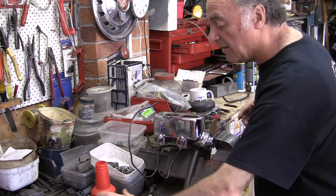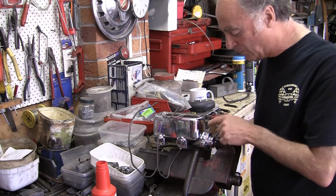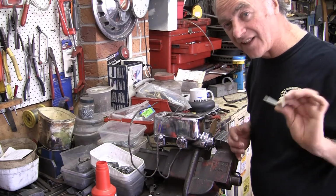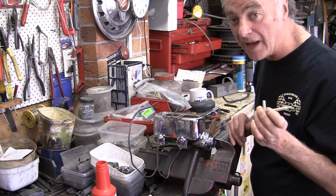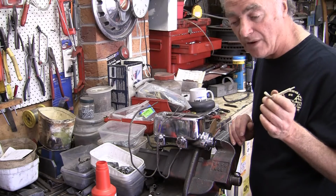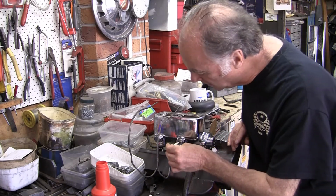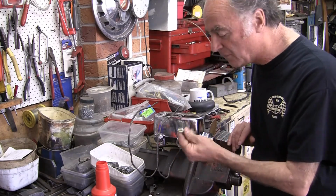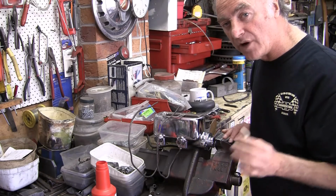The other thing I noticed is that the brand new 1-inch master cylinder I bought from Summit didn't come with a tool. Somebody's taken it out of the box. Lucky I still had this tool from the last master cylinder, which is a 1 1/8, and it's a small Allen key. It fits right in here and goes right in the guts, and you turn it for pressures, and the big one does the outside one. That gives you the different pressures on the rear drums.